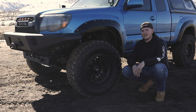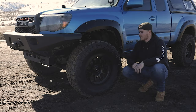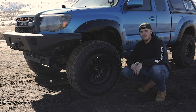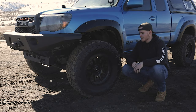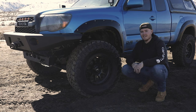The Wander Taco sits on a six-inch Rough Country lift with SPC upper control arms, which are fully adjustable for caster. It just got some new lower control arms so the whole front end is sitting pretty nice. We just got some new tires — 35 by 12.5 R17 inch Nitto Trail Grapplers, our first mud terrains. The wheels are 17 by 9 VTX Rogue wheels with negative 10 millimeter offset.